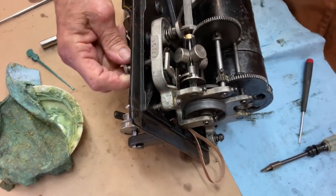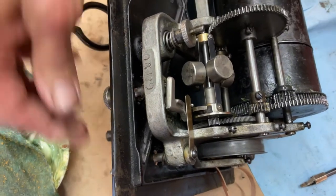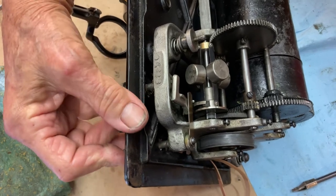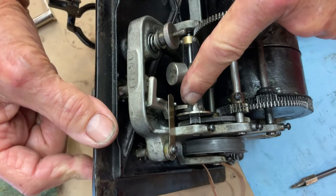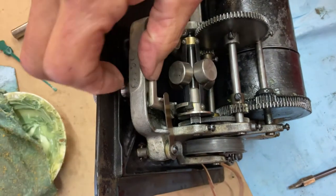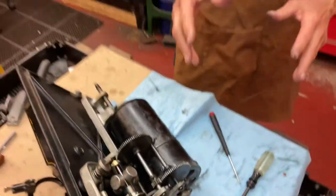Now you back the speed control out. Everything's in place, and then you watch the little L thing here. That's stop — you see how the felts hit? Right here. Now watch — that's on. That's off. That's on. And it's in place and it won't go anywhere. Now you're going to have to put the belt back on the machine, crank it all the way up, and reset the RPM or timing of the phonograph. I use a digital tachometer, which is an absolute lifesaver — they're like $20 off Amazon, I'd buy one. And you're good to go and you go play music. I love this hobby, and that's my tip for the day.